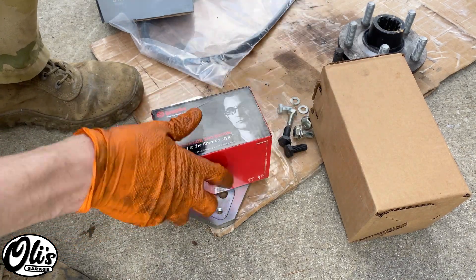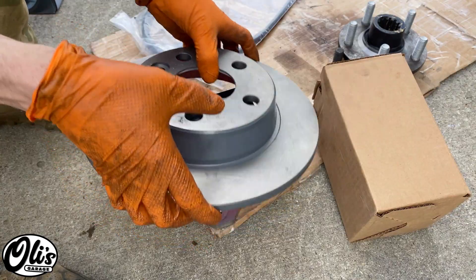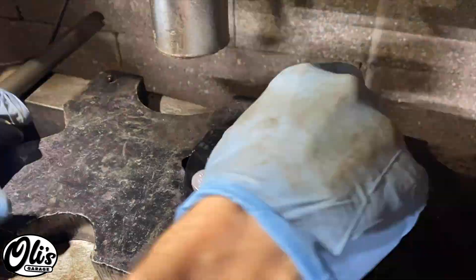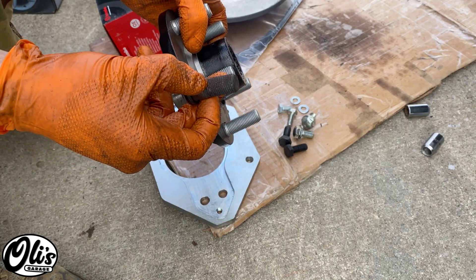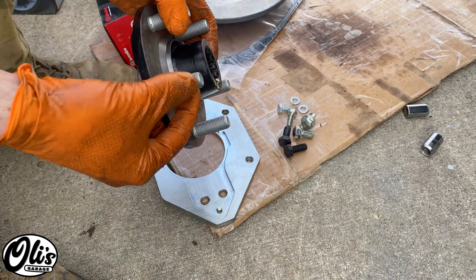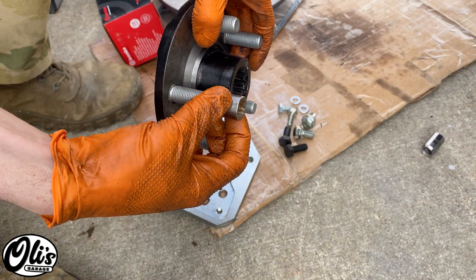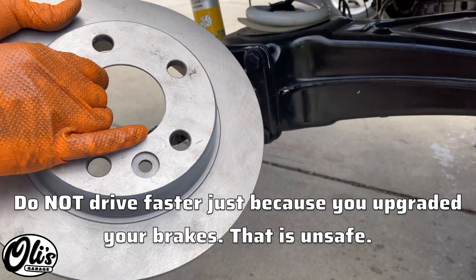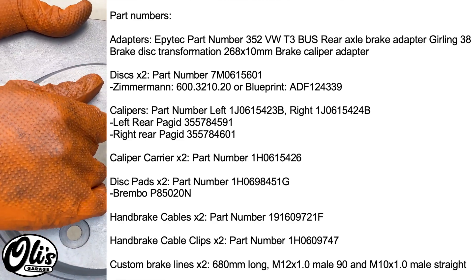With this kit, you can choose the type of pads, the rotor brand, and the calipers you want to run, and it is extremely reasonably priced. If you get your hubs machined, you need to press out the original studs and put in longer studs. These are 35 millimeter studs from the factory, and they're 10 millimeters shorter than my 45 millimeter ones. Since the brake disc is thicker than the original brake drum, we need longer studs so we have enough stud engagement when screwing on the lug nuts — otherwise the lug nuts will only go on two or three turns, which is never enough at highway speeds. I'll have part numbers and links for all these parts in the description.